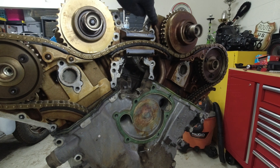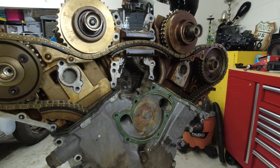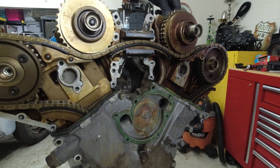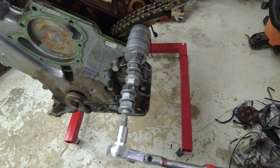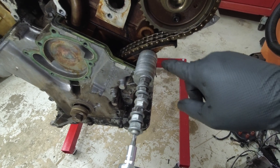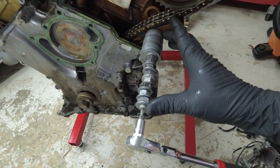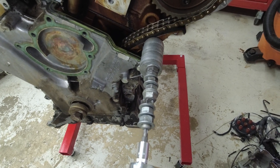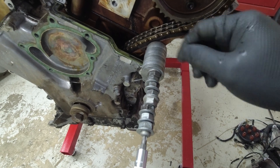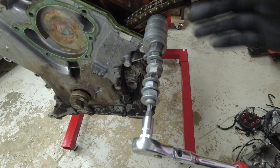Next, we're going to remove this ventilation pipe — it goes right here and comes up, with one T40 at the top. For the guide rail pin, it requires a slide hammer that I don't have, so I used a really long bolt that was the right thread size for the guide rail pin, with washers big enough that the pin can come through, and I'm just threading it out until it comes out.